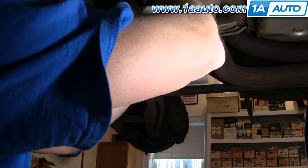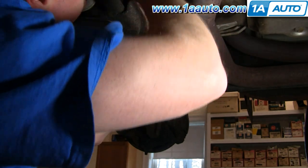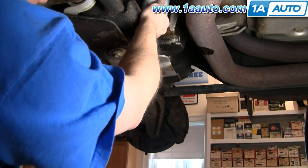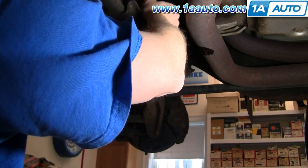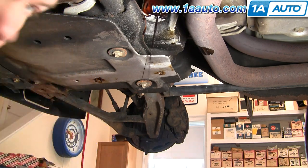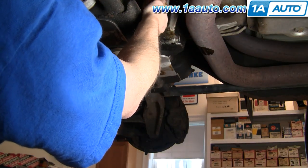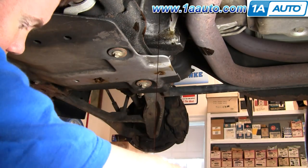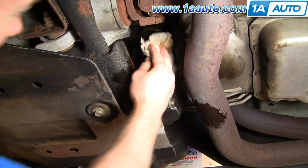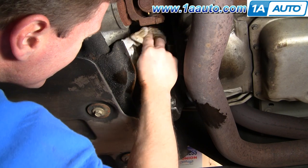I've got my oil filter wrench — you wrap the oil filter wrench around the filter, get it turning a little bit, and then you can just turn the oil filter off. As you can see, as you're doing that, oil will start flowing out. You can let it flow for a little bit. Once you have the filter pretty much all the way off, it just drops down and you put it right in your catch pan and let the rest of that oil drain out. Use a lint-free rag or a paper towel and wipe off any excess oil that's on the oil filter base.